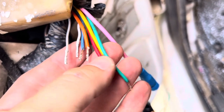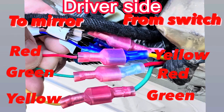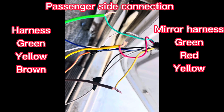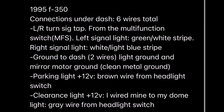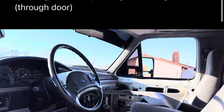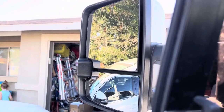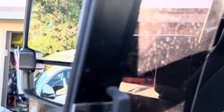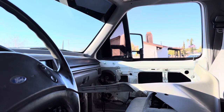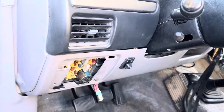Right here, this is all the wires I passed through the driver's side grommet. The power tap for the mirrors is that light blue with a dark blue stripe. Here you can see the harness under the dash on the left and then the mirror harness on the right. I mostly got everything back together — figured I'd just do a little test for you guys. There's the button. Switch it over to the left — left and right, up and down. Change that over. Easy peasy. That's it on the mirror conversion.